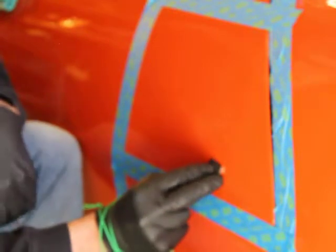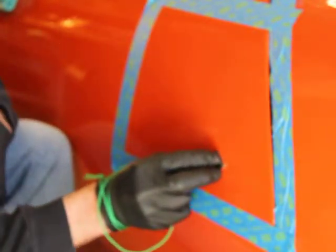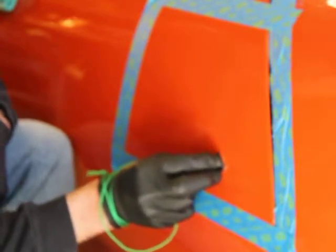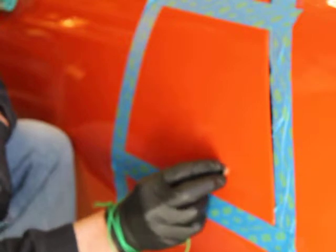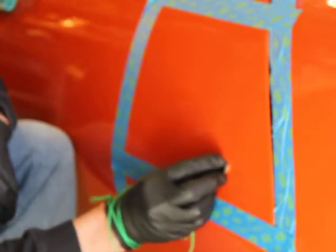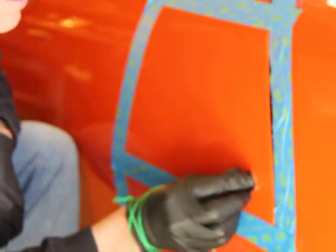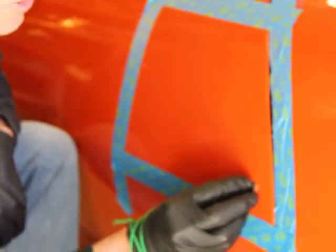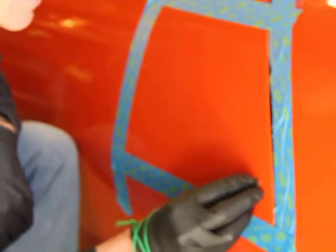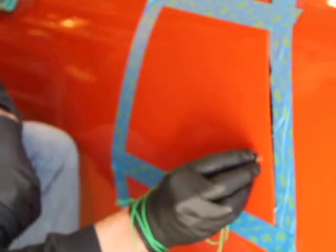Start right here. You've got to be careful on some of the angles, especially if you're at an angle, but this little guy will take them nibs out without damaging the surrounding areas. You want to get that out because even with the 1500, it'll take them down, but it also leaves a spot around them. So you want to try to get these nibs out of there the best you can. Makes everything a lot easier.